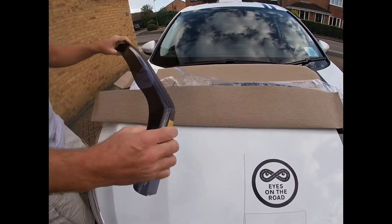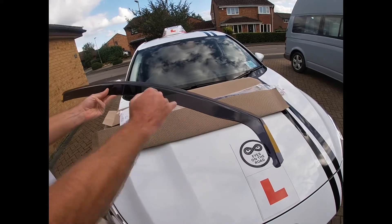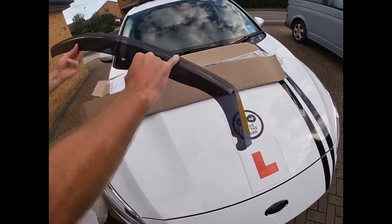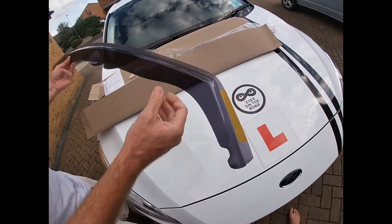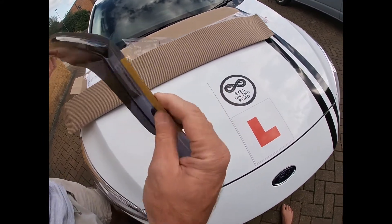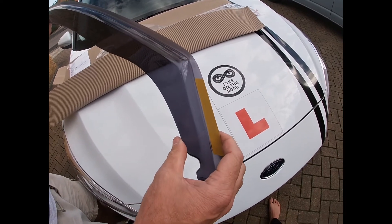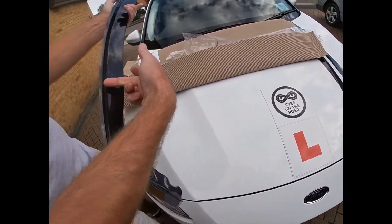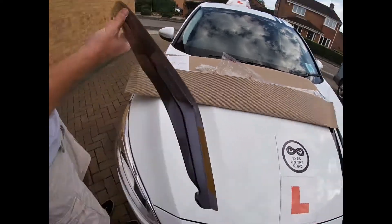As you can see, it's just the plastic deflector with a grooved top that will push into the window channel slot, and then some double-sided tape which will peel off once we're sure, and that will attach it. Then there will be a couple of clips that we fit into the window channel. So that's it in theory - let's see how easy it is.